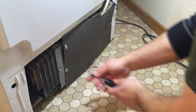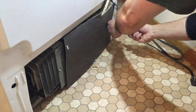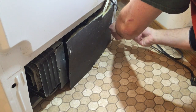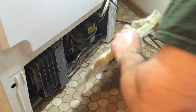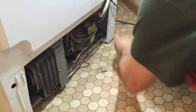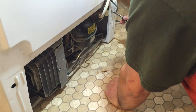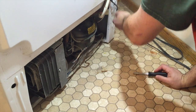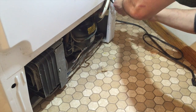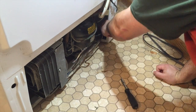To gain access to the defroster timer, it's just two quarter-inch screws on the back. Keep track of those. There's always going to be a little bit of dust bunny action going on. The timer itself is located right here — it's just a matter of more quarter-inch screws holding it on. The screws didn't fall off, but the timer did.